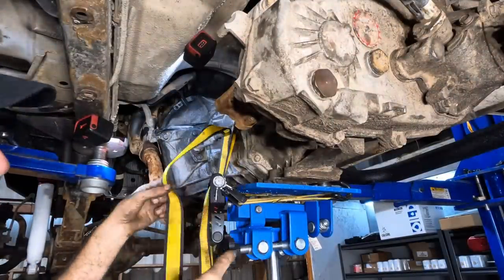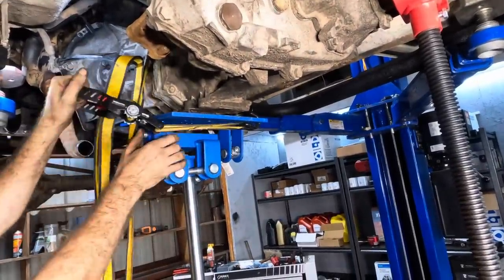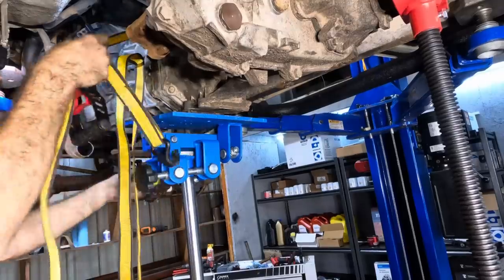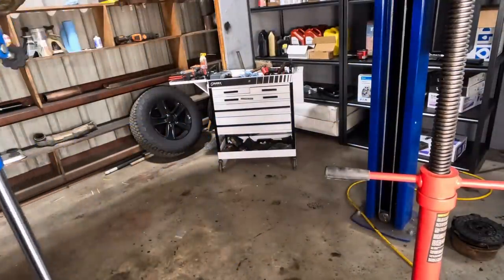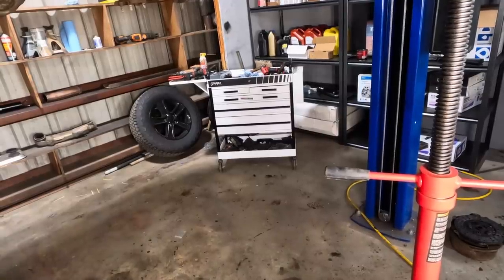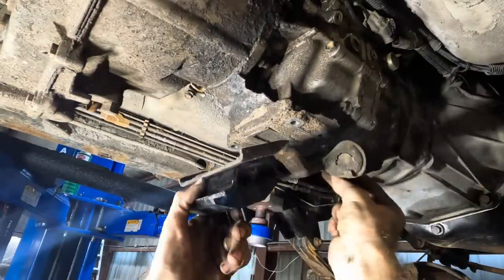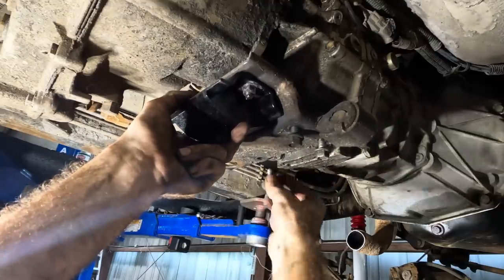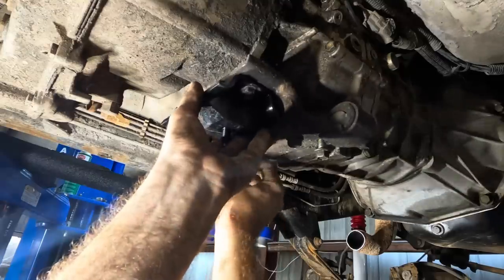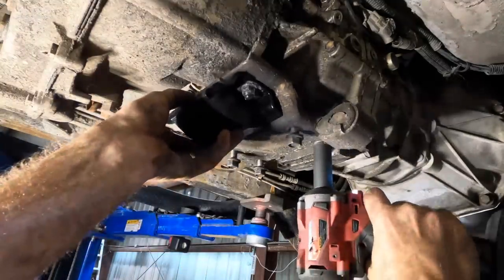I need to get this trans jack off of the trans. I have the tail shaft support over here — we're going to put the big plate and the trans mount back up. I've already connected the wiring harness and vacuum lines while you guys weren't looking. Trans jack coming down, get this thing out of here — we're done with you for now. Let's put this plate with the trans mount back in. I've got a new one — it's bolted on, ready to roll. Let's get these guys in, then run them down, then get that big skid plate slash mount device installed. I removed that broken grommet thing that served no purpose — it was damaged so I took it out.